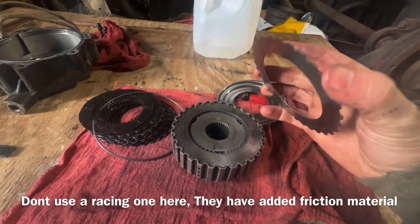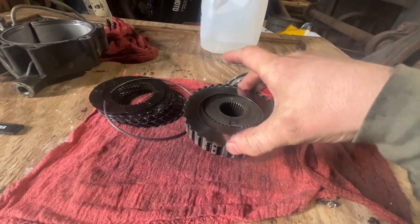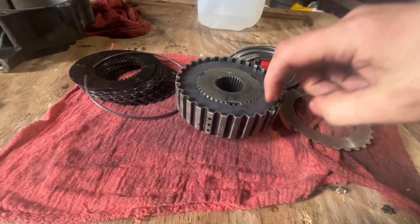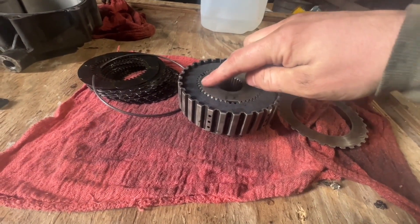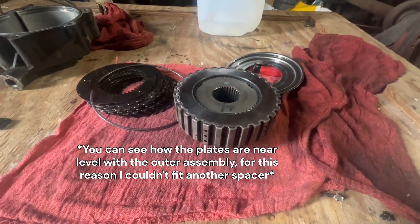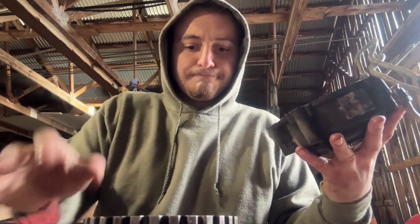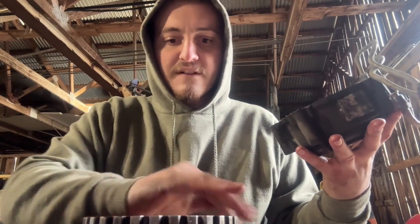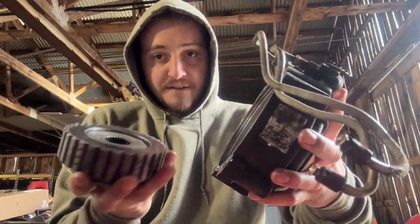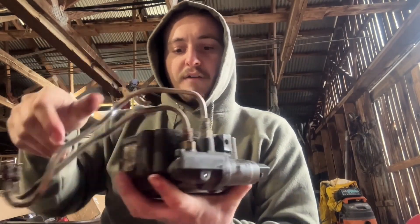Take an extra thin plate as a spacer. The thick plate absorbs the heat from the friction going on in the clutch pack, and this thin one stays away so it won't warp. I can't do it the opposite way — leaving the thin spacer all the way in the back — because then it raises up the assembly so the friction disc isn't riding on the inner set of gears. It has to go all the way in on the outside. What this does is allow the piston to not have to travel as far to engage. Pick up your housing, make sure your hands are clean — this is your last chance to get the dirt off. Carry it sideways so the plates don't fall out, then tip it upside down and set it down gently.